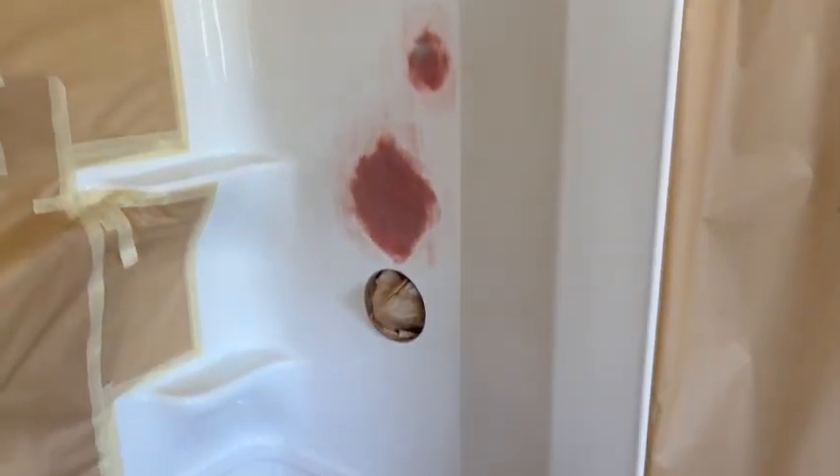We're gonna put two more coats of the lacquer glaze. Getting ready right here — got it all taped up. We're gonna do our spot blend first. I'm gonna wipe all my bonding agent on the edges, then do all my flip tape. Flip tape is where the tape flips backwards so you can get a nice blend edge. On something like this I'm gonna do a zone blending technique, so I'm not gonna try to keep it as small as possible — I'm gonna blend it out.